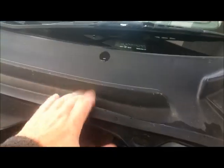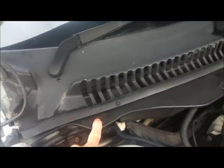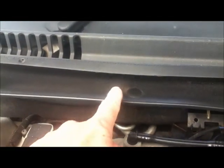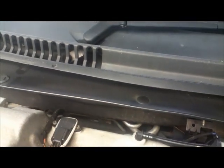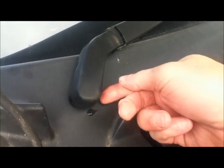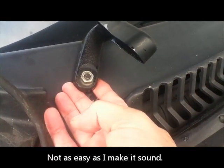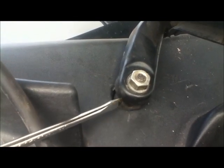I'm going to take the plastic trim off and have a look at what's underneath. I also know the cabin air filter is under here. The windscreen trim is held on with speed fasteners and there are five of them — the guys who did the windscreen managed to lose the middle one, so I replaced it with a Halfords one. Then the windscreen wipers have to come off: the plastic caps just lift up, and I need a spanner to undo the 13mm nuts.